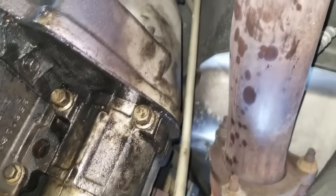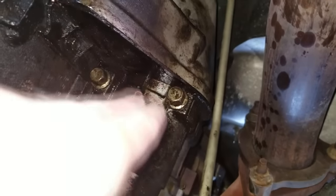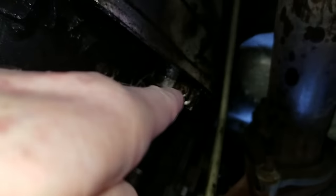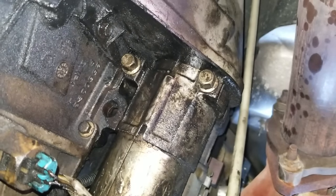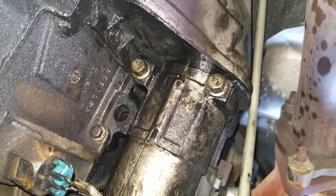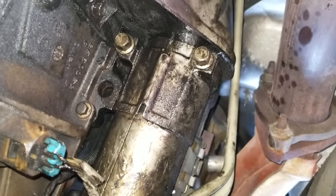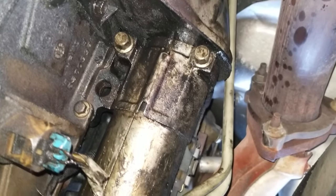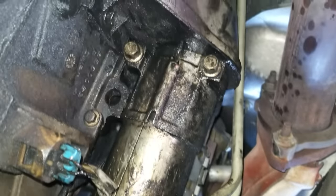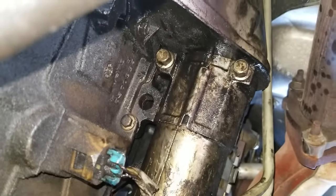We can see our starter here. You have your transmission case right here that's blocking that bolt a little bit, so you're going to have to slip on the socket — it's a little bit tight because of the transmission casing. I would recommend spraying it with WD-40 and let it sit for about five minutes. What we actually had to do is take our socket set with extension and use a hammer in a precise position — hammered the end of the socket wrench and that loosened it up, then we just put some good muscle into it. You'll actually hear a pop depending on how hard your bolts are sealed on there. Obviously, lefty-loosey counterclockwise is loosened when you're looking up at it.